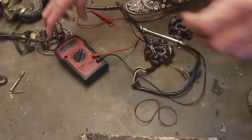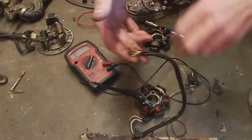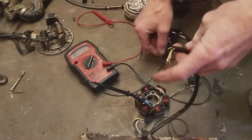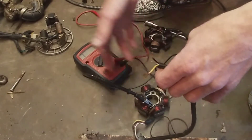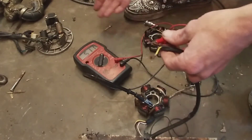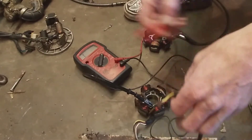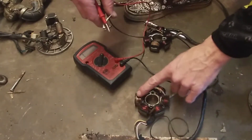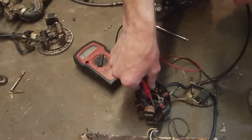Let's pull the plug. I've got a couple of six-wire coils here we'll just check. If this is in your scooter, you can just unplug it from where it comes out of the flywheel. We're going to test this red and black wire. Put your voltmeter on the ohm setting — this one's going to be on 2000 ohms. Clip to your frame or a bolt on the frame, then check the red wire. This particular one reads 510 ohms. That measures the resistance in the wire — this is actually your stator charging coil we're checking.